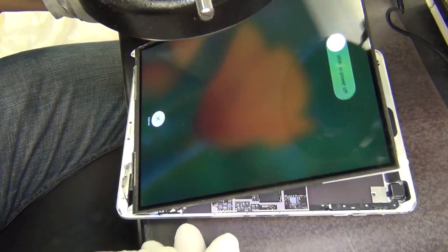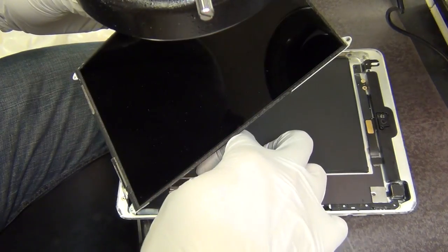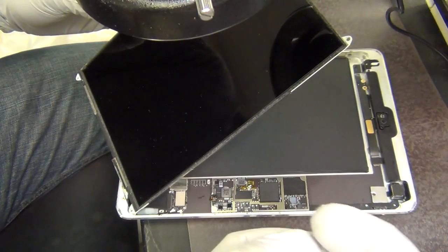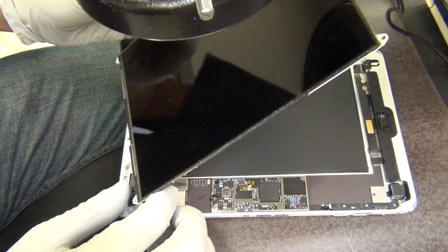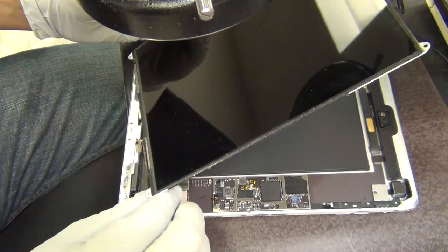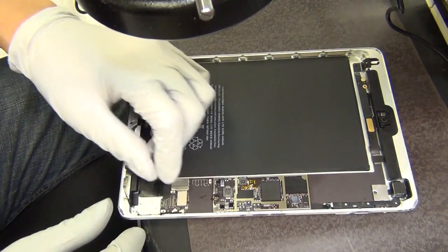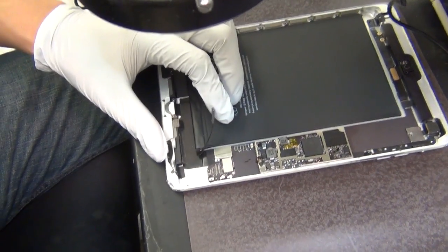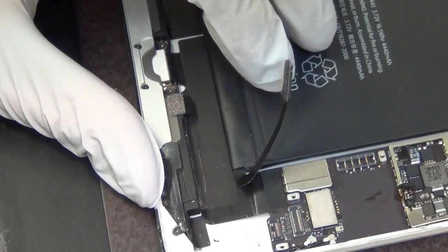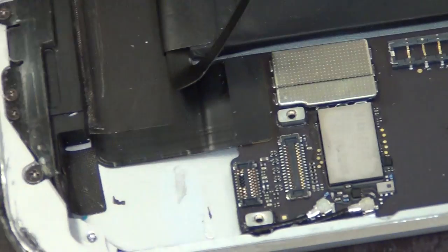So what you can do is unplug the battery — it's always safe because the moment you unplug it everything is off. The reason I did the backlight first is because we still have the touch connector that's damaged. This connector is really easy to damage — it's partially due to the fact that it was designed to be very fragile. Also, I think Apple put some glue on this connector that makes it really frail.